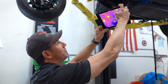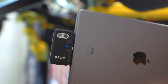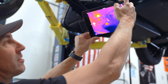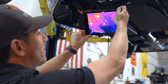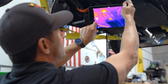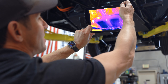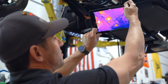We also like to go through with a FLIR camera — thermal imaging. I go into the car after we've preheated everything and check for any abnormal hot spots. We actually found a leak this way the other day — one part was getting a little warmer and it turned out it was leaking. You can see there's a pump right there that's obviously a warm spot because it's been running, and a hot spot up where the radiator was. If you have one of these cameras it's really fun to see where things are getting warm — just another tool in our arsenal.